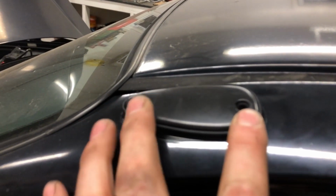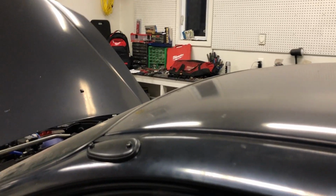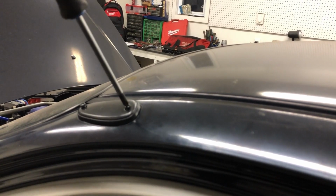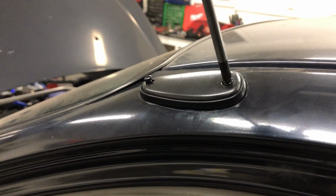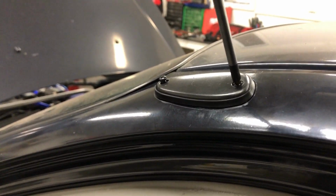We can now go ahead, reinstall our 2 copper washers, and install our new hardware. I prefer hand tools for the installation of smaller fasteners such as these, since they often have no torque spec at all, or a torque spec in inch-pounds, which you often won't find a tool ranging down to such a low limit.